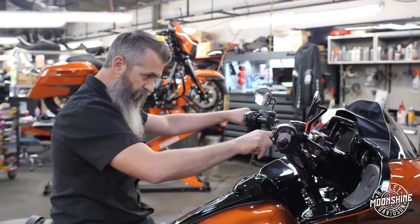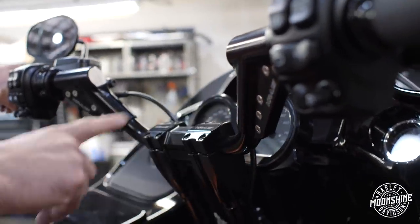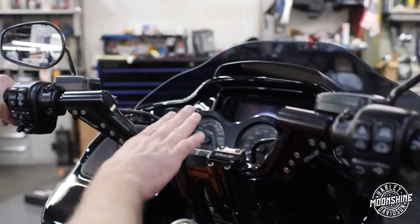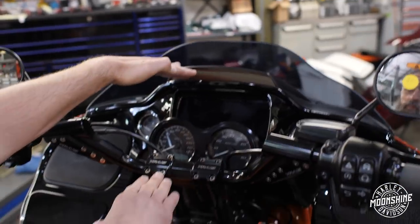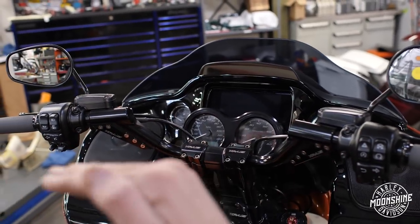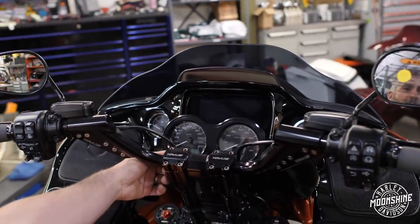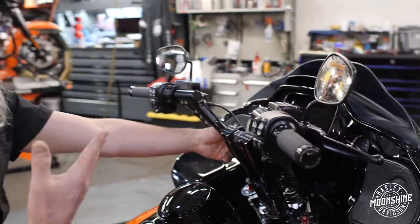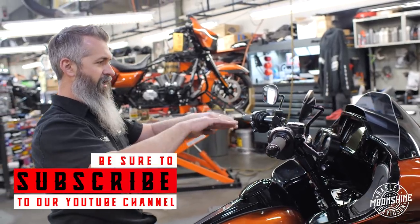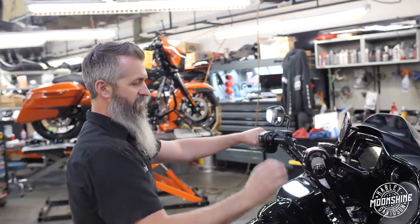It's an all-aluminum bar setup and these three bolts right here can be loosened and allow us to change the pitch of the bar back to the rider. You can sweep them in a little bit or push them out straight depending on your comfort and style. The traditional fly bar has about a two and a half inch rise; this one is about a four and a half inch rise. With the four and a half rise, it sweeps down more and gives us more room between the top of the riser and the radio. That allows us to angle the gauges a little more towards your face and tuck them down so you can see the radio and the gauges. I'm 5'11" and seeing the gauge up to where my finger is. About 85% of the screen is visible — just the bottom is blocked by the top of the gauges.